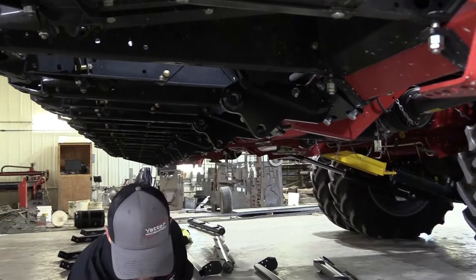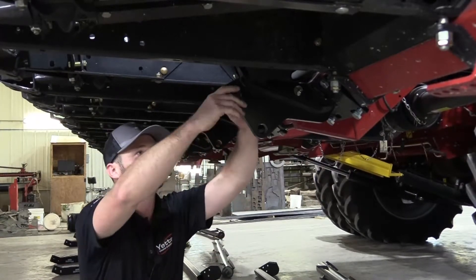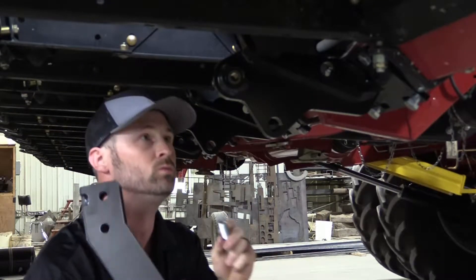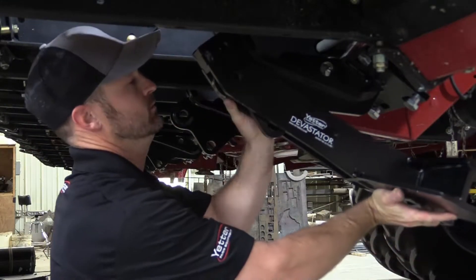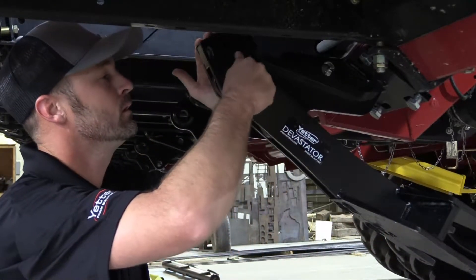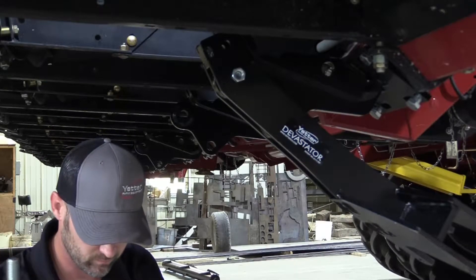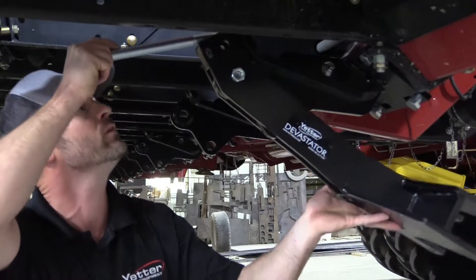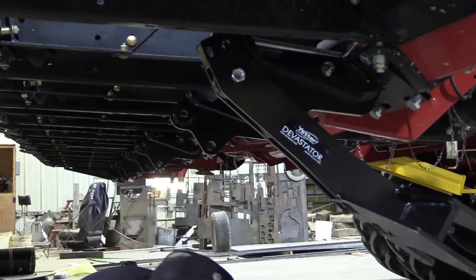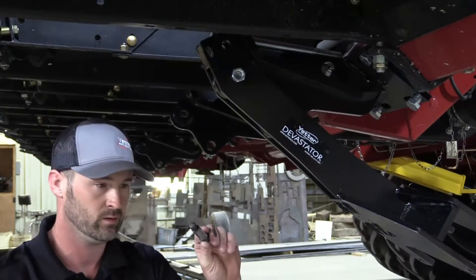The next step is to open up our bolt bag with all the spring hardware. The first thing you'll need is the bushing — we're going to tuck it into this arm right here. Then you'll take your arm and mount it with the 5/8 bolt and nut. Next, we'll take the long eyelet bolt and put it through the hole. Then take the half inch shoulder bolt and two 5/8 washers — these washers will go on either side of that eyelet and this bolt will capture it.